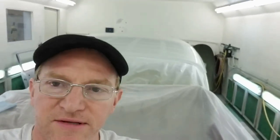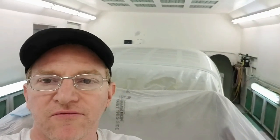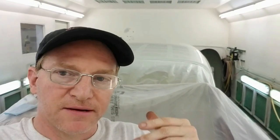And that's 3 coats laid just now. Now it's gassing off, which means the clear is dying back. It's the gas off time now for the clear. I did half hour intervals between each coat. Now if I didn't do that and I started laying it on, I would have something pop up the wazoo. It would be real bad. It would be an expensive recycle. 12 hours is not what I want to do on my list. I want this one and done. Just texted Lee, see if I can get him in here and have him knock it out.